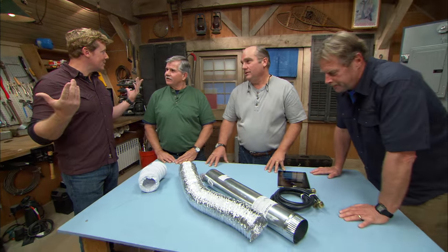We got a new washer and dryer, and not long after, the dryer wasn't getting clothes dry. We called the company expecting to schedule a service call, but they said to take the phone, put it down to the dryer, push a special button, and things started communicating. The technician said it's not the equipment — you have a blocked vent. And sure enough, we did. It saved us a service call.